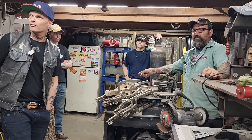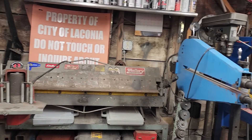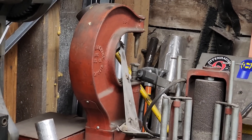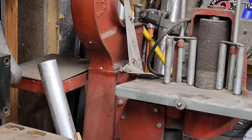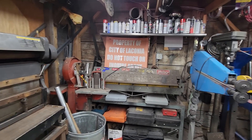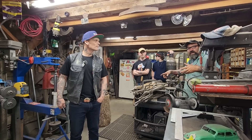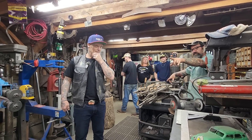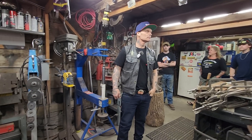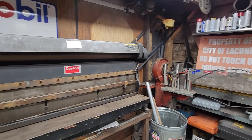That red arbor is a brake lining reshaping machine. Most people don't realize this, but if you take brand new brake shoes for an early Ford, they only hit on about a half-inch of the drum. You take that machine, remove your brake drum, and shape your shoes so that when you put them in the drum your shoes actually fit and work properly. It gives you a really good brake. What's happened over the years is the shapes of the forms and dies to make the shoes have changed. It's actually a machine from the 1920s — it has a little drill so you push a button and it punches the rivets out.